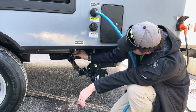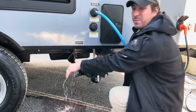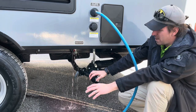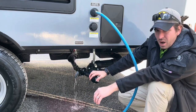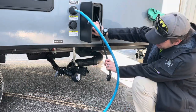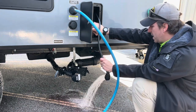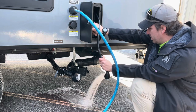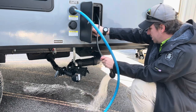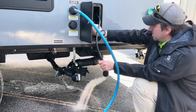Not everybody has the ability to dump 15 feet from where they're winterizing, so I like to get this started first. There should be two low point drains — one for hot, one for cold. I'm going to get this drained, and then I'll show you the next step. This Apex 194 is really nice because our next step is right here at the outside shower — we're trying to get as much of this antifreeze out as possible, clearing each line one valve at a time.